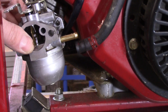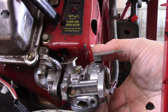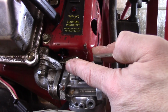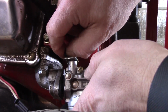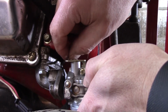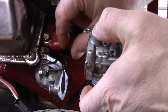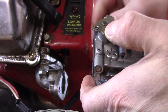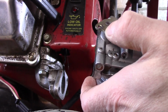Okay, let me switch around to the governor assembly. This is the part that we were looking at when the engine was running, and this governor assembly is what sort of maintains the engine RPMs. There's a little arm, and then there's a spring that you don't want to pull apart also. So it's right here. I'm not sure if you can see it or not, but I'll try to get a better shot when we assemble it.